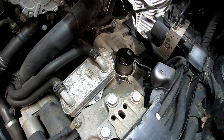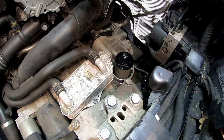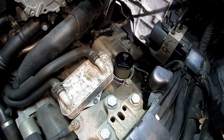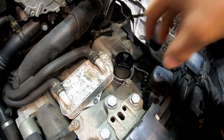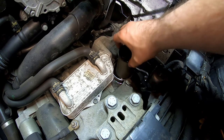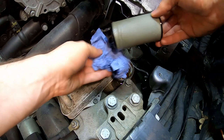This helps the gearbox drain its fluid faster because we're allowing air back into the system as the fluid drains out. It's a very viscous fluid — it takes a long time to fill and a long time to drain. So the fluid's been draining for a little while now; we're going to pop the filter out. You can see this is a Febi filter, part number 44176, and that's exactly the same as the part we're going to replace it with. This just lifts out and we can let that drip into the housing.